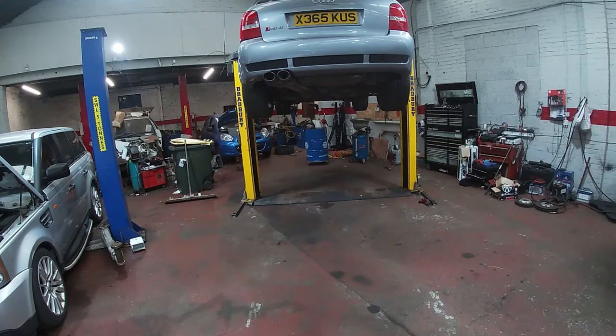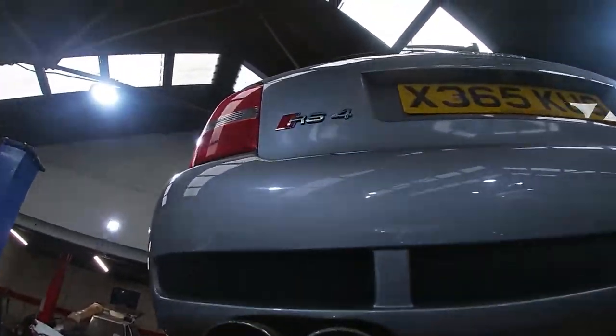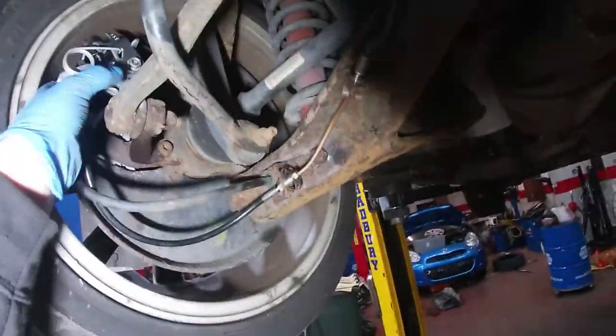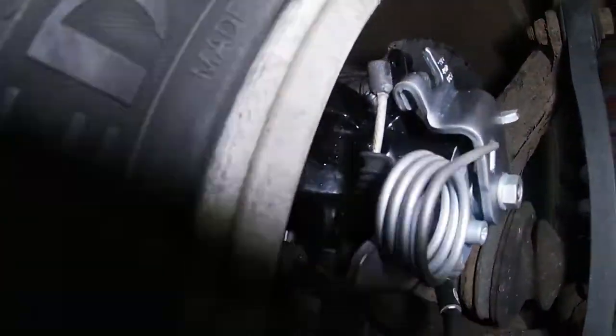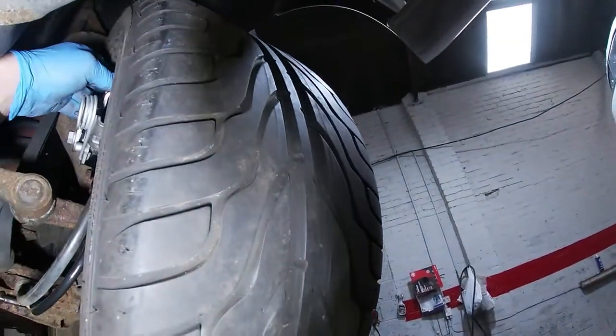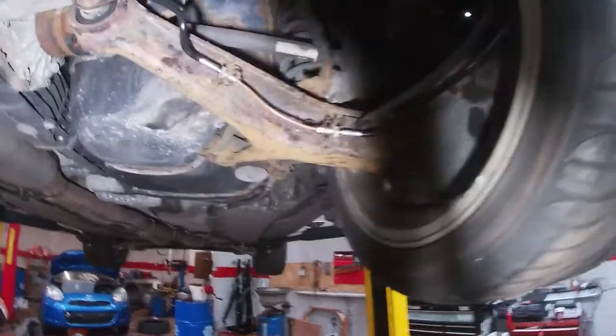You've all seen I've been fighting the rear brake pipes. We've got these new calipers, put our horseshoe clips back in — they're all in there. We've got a little brake clean done, and I'll hook those brake cables in there. I do need to hook up the brake cables still, so I've just put the wheels on because I'm going to sit the car down on the ground. The brakes are all bled — I did that off camera because it's very noisy with the compressor and the air bleeder going.